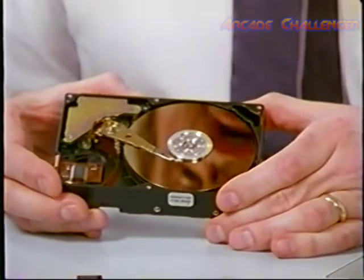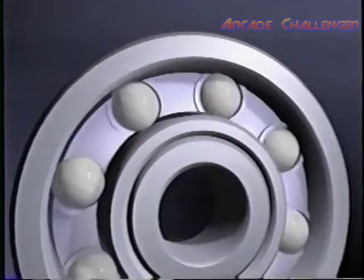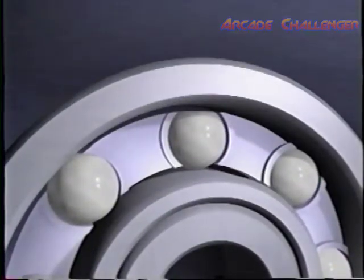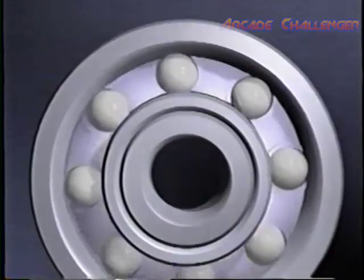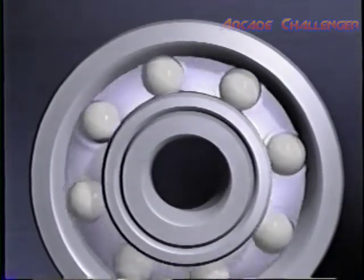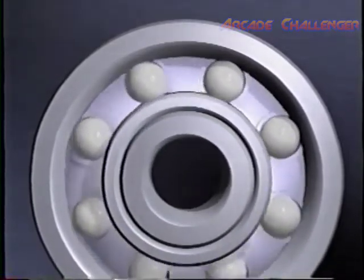In addition to the damage caused by head slap, dropping or bumping can also cause serious motor bearing damage. When a drive receives a shock sufficient to force its motor bearings into the shaft, it can create flattened areas on the otherwise perfectly round bearings. Damaged bearings like these produce increased vibration, more noise, and additional heat, factors that will lead to greater problems later. Again, by following just a few simple rules, each of these problems can be avoided.